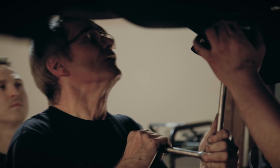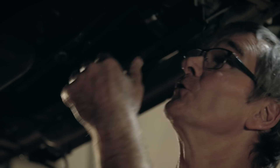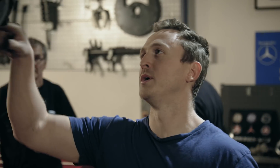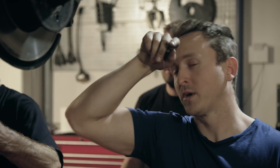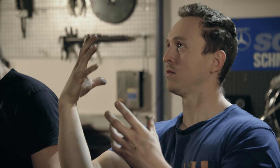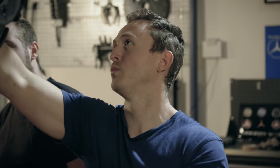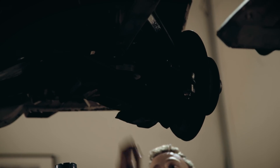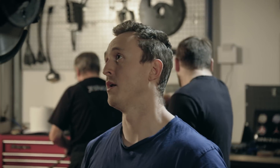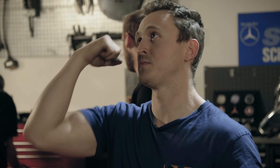Brakes checked. It's now time to whip out Heinrich's old suspension in preparation for the new H&R set. We're trying to take the old springs off, but the spring compressor we have isn't compressing the spring enough because we're bottoming out at the top. So what we're going to do is take this jack, jack the whole system off, take away the pressure, and then we should just be able to slide the springs out.